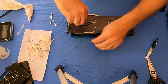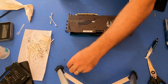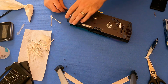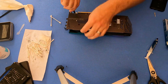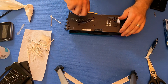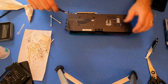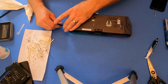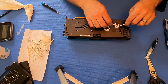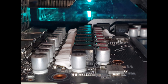Then you want to get your screws started but not tightened just yet. I also like to start the rest of the screws so that everything's lined up and you're not hunting for threads later in case something shifted a little bit. Once all the screws are started, I do the star pattern with the four spring screws. It's worth noting that this Zotac doesn't have a tension bracket like a lot of the RTX 30 series cards, so it does use those spring screws. I'm just cleaning up the excess thermal putty with some Q-tips and smoothing it out — this stuff won't leak oil at all.